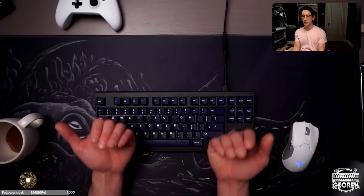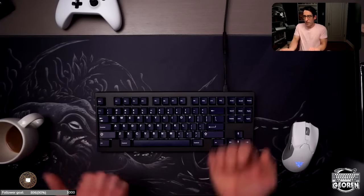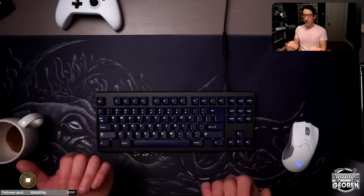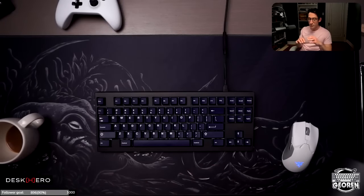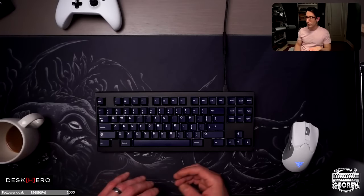But there was this stem wobble in a north-south direction this way. If I'm looking at the top of the board, it was doing this. So when you push the key down, it would wobble a little bit and then you'd hear it kind of rattle on the way up. And it was like, whoa, what is that noise? The stab wasn't making noise. The keycap was making noise on the upstroke. And it was like, what? This is nonsense. Anyway, took it out.